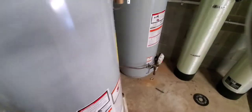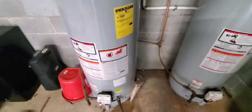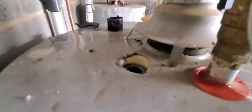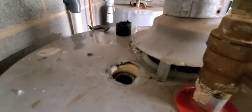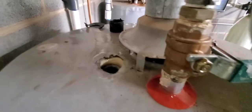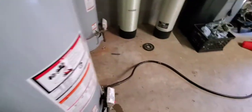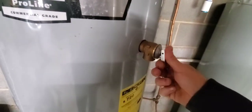Now that we've got it out, we shouldn't have too bad of a smelly water situation. I'm going to make sure the drain is open and turn the main feed back on nice and slow, just to try to drain the tank out and lift any trash out of that hole. All you have to do is crack that valve and it'll flow out any trash in the threads. We've got some water coming out here and the rest is going out through the hose.